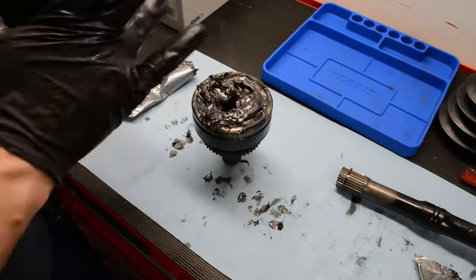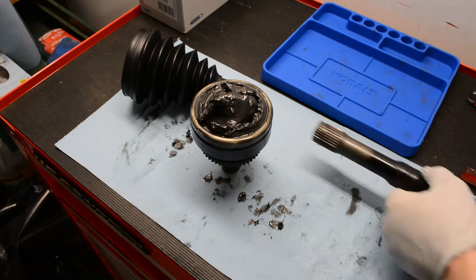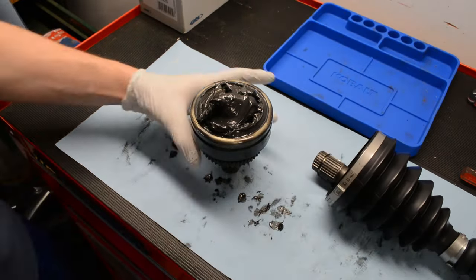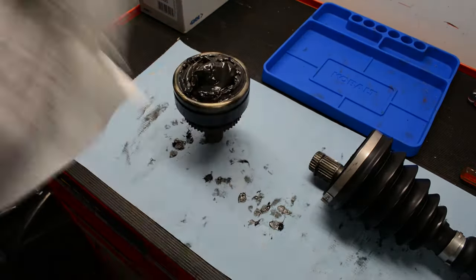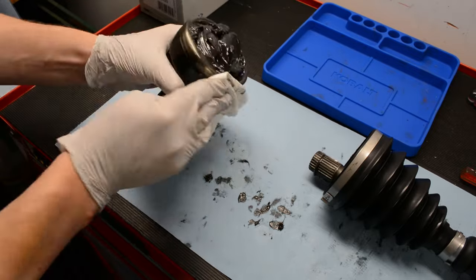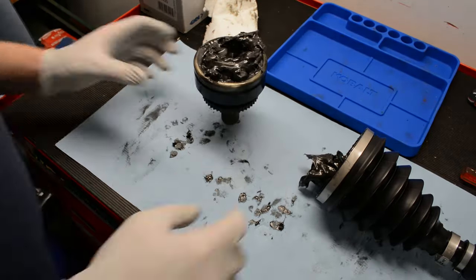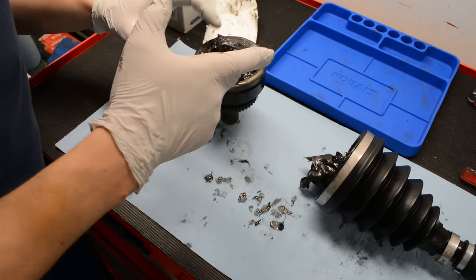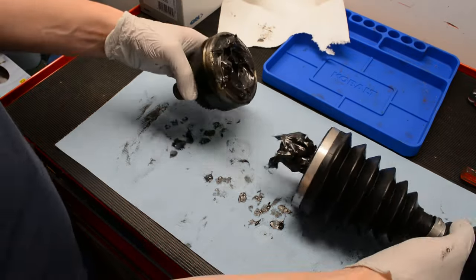If you have any questions about this, leave a comment and I'm happy to help. Since the inner joint is already finished, when you put the outer joint together you don't have access to the other side, so you have to slide the clamp and boot onto the axle shaft before you load the bearing assembly and housing. On a Volvo axle, what holds it into the transmission is a little lock ring, and you have to smack it in until it interfaces properly and is locked — the outer assembly attaches to the shaft the same way. The best approach is to have the open end on the bottom and the closed end on top, and let gravity help you.